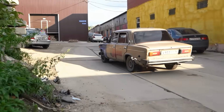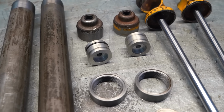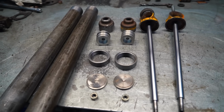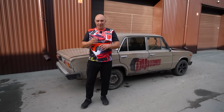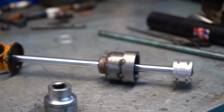Check this out, guys. This was fairly interesting. So a cylinder, a rod that we pulled out from the old shock absorber, the seals were in good condition, but that you can easily make yourself, fit an O-ring and you're good. You can machine all of the necessary parts, and the piston, well, four holes, hydraulic fluid, a nut so you can take it apart and pour it in. We could have fitted a filler valve, but the nuts seemed to be the simpler solution. We also wanted to have the option of dismantling it just in case.